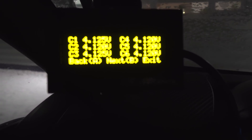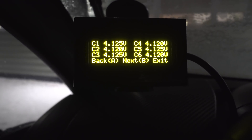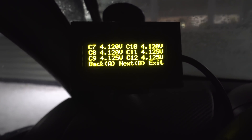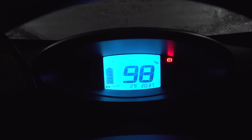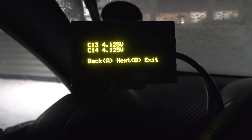4.13 — but that is a bit concerning: why are those two at 3.88? This ain't good. I've just turned the ignition on and those cell voltages have changed now, so there's something really strange. It must just be a glitch in the PowerBox software because they're all showing 4.12. That page is all right — 4.12. That last digit is either five or zero so it obviously rounds to that. They see those two just flip onto five there. It's interesting that it's changing; it's also saying it's charging, but all I've done is turn the ignition key. 4.125.